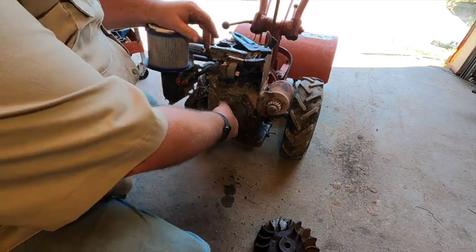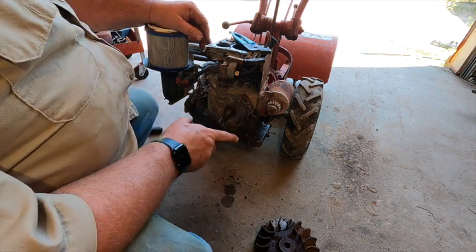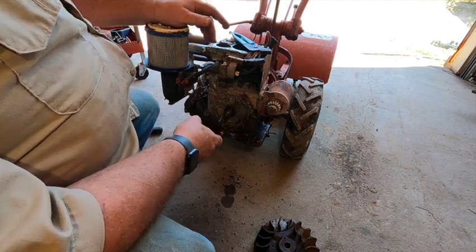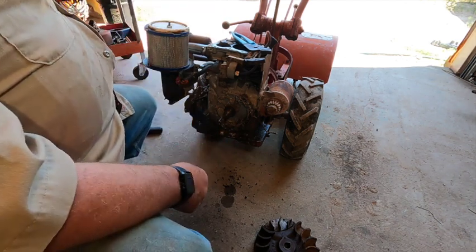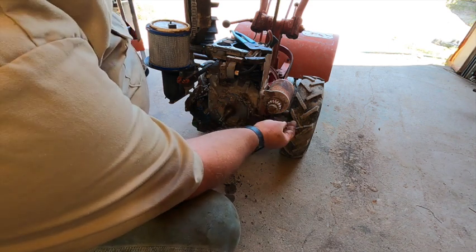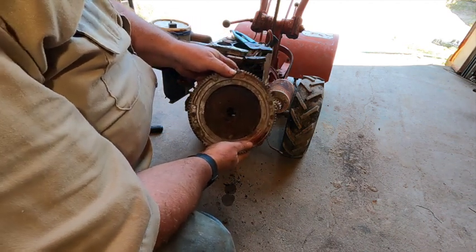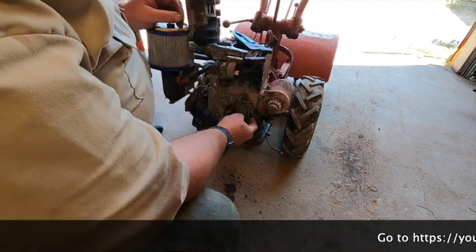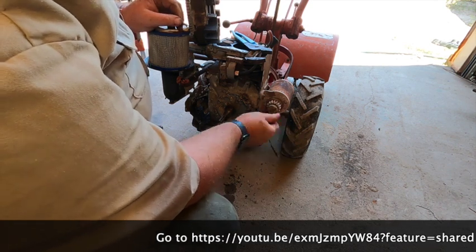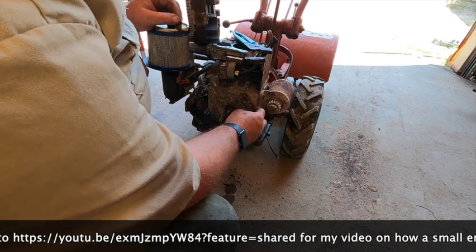There you have it - a magnet busted loose from the flywheel, got wadded up and wedged in there. The flywheel stopped turning. You've got a set of windings right here, a wire coming out, and a set of magnets inside the flywheel. This, my friend, is the alternator - because it's an electric start engine and it just puts a charge back to the battery.